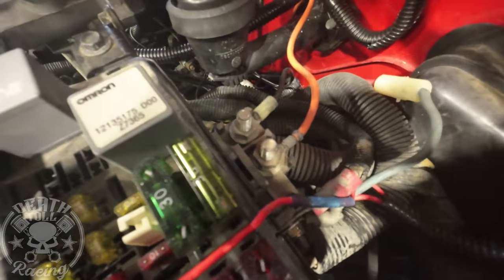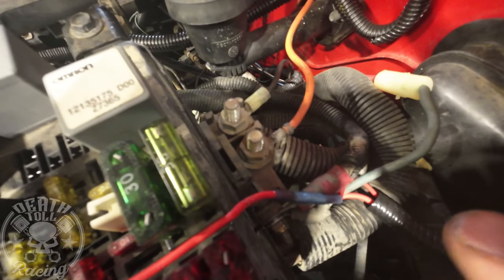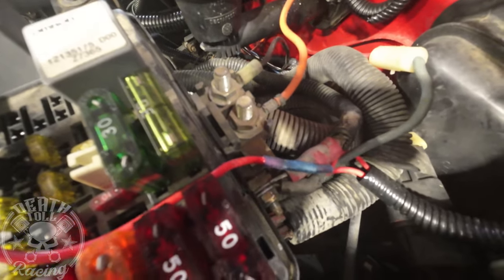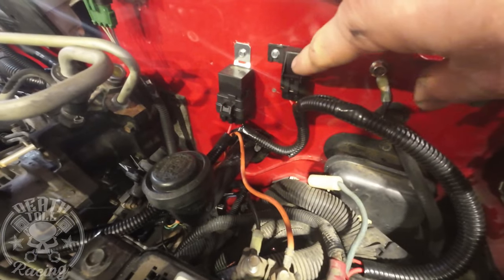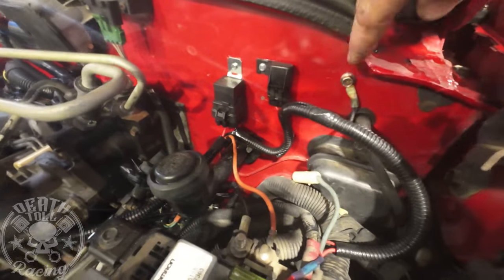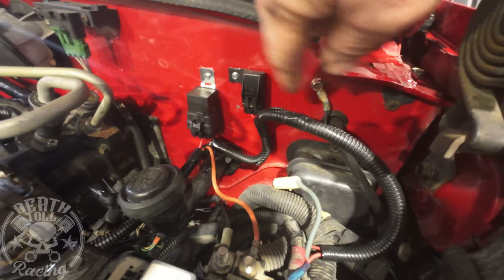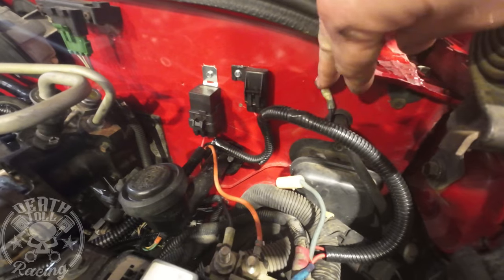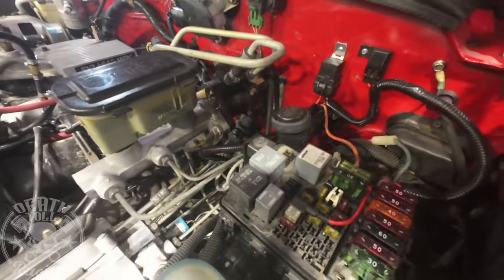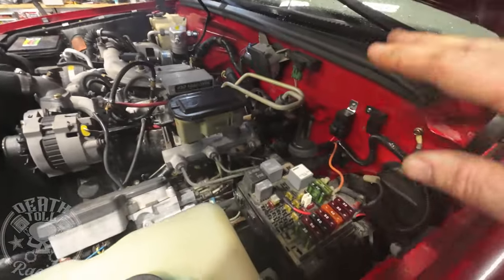For powering the whole system, I just chose the inlet power going into our breaker panel. The blue line going out is actually a fusible link going to your glow plugs, and that should be the only thing on there now. That's where I chose to put the power going into our AirDog system — and this fuse for the AirDog system comes with it as well. I cleaned it up and mounted it to the firewall — I made a ground post there using a stainless steel thread insert rather than just a sheet metal screw. If you don't have that, go to a good ground stud somewhere else or the battery itself.